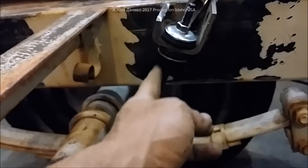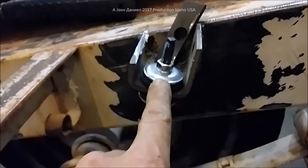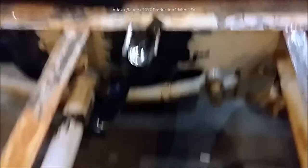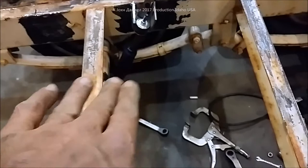This shock has one inch more of travel than the other, and it's been compressed one and seven-eighths of an inch to fit in here and clamp down. Down at the bottom is the perch I made for it to mount on — none of it cleaned up yet. The shock is installed in the trailer. It was put on this side because of the swing effect of this set of spring carriers, which allows travel on this side so the axle can move and absorb shock. The reverse applies on the other side, where we'll be putting the next one.